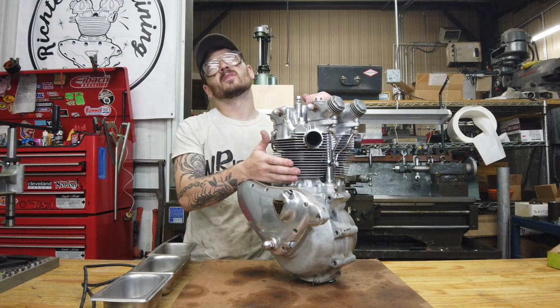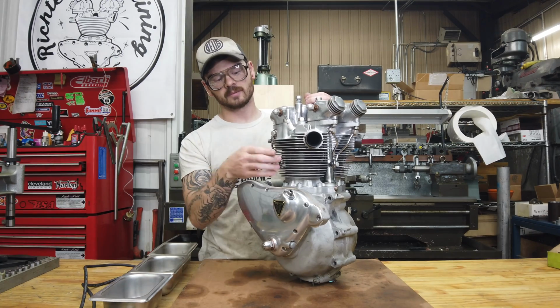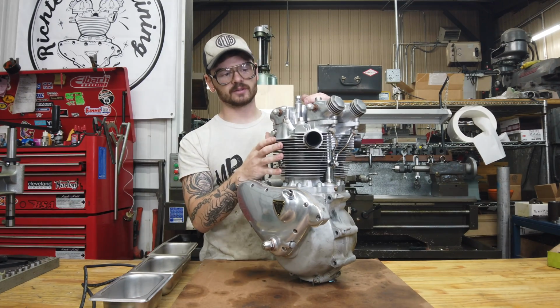They were 60 over with knurling on the pistons. It was a really bad deal. So we put new liners in, back to standard, fully rebuilt the head. Super great, turned out good.